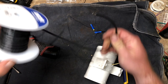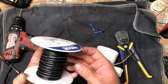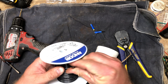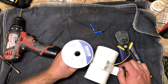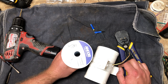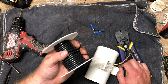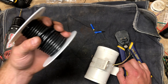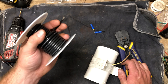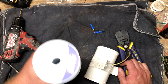This is just one of those mechanics' tricks to keep in the back of your mind. If you're ever running wire on the outside of a car — say to run a winch or whatever — and you're in a high moisture environment, or you live up north where they pour a lot of salt on the roads and you're worried about corrosion, get marine grade wire and use solder connectors. You'll never have to worry about wire corrosion.